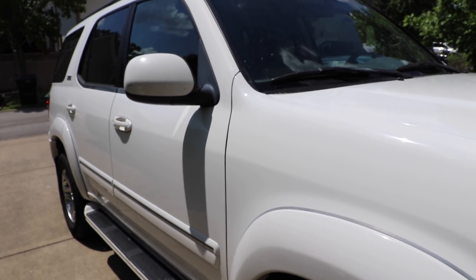Originally when I started this job my first response was to use Meguiar's 205 finishing polish, because in a lot of cases oxidation can be taken care of just with a finishing polish. However, the more I started polishing the more I realized that Meguiar's 205 was doing a good job but wasn't going to do a perfect job. It wasn't going to restore it to the condition I needed and wasn't really removing the full oxidation.